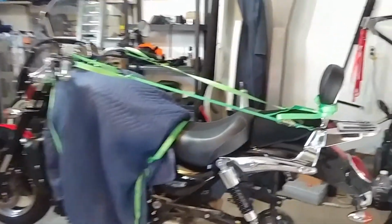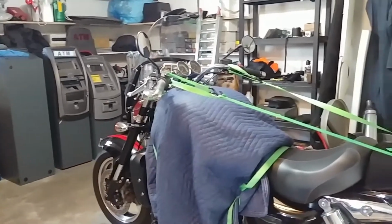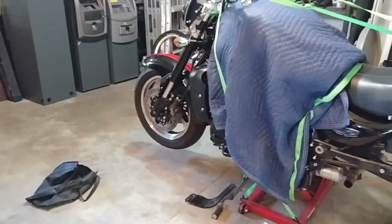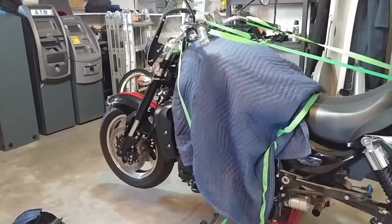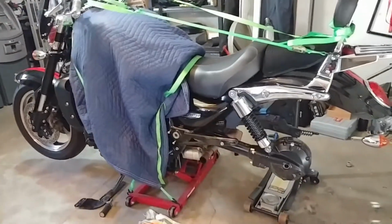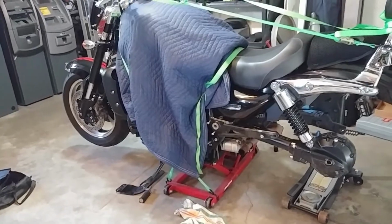And in case you're wondering what the straps on top are for, it's just holding the handlebars straight. I mainly just did that for demonstration purposes because I didn't have to do the front tire. I only got a nail in the rear, but that is bloody handy when you're trying to do the front tire job as well. So yeah, having your wheels straight like that or the handlebar locked like that is really handy. Plus it just keeps it more stable on the bike as well. So everything's balanced.